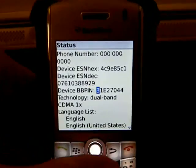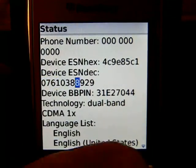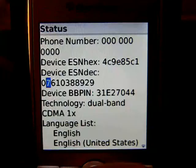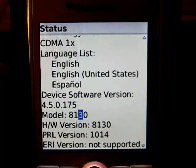They're going to ask for the serial number and for the model. They'll call it a serial number. What you're looking for is the line that says ESN DEC — that's the ESN in decimals. It's an 11-digit number, and if there's a zero at the front, include that as well. Give that number to them, and then they're going to need the model. Scroll down to where it says model and give them the model — it's a BlackBerry whatever number.